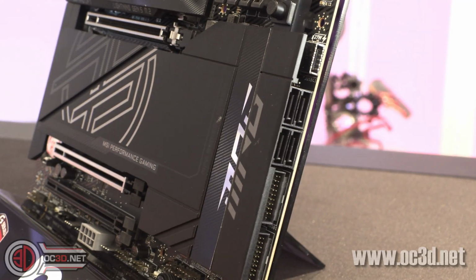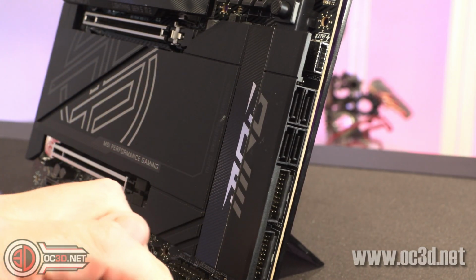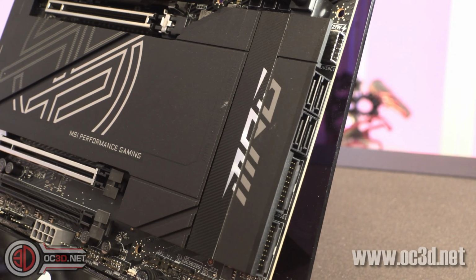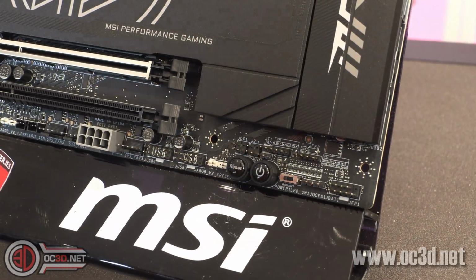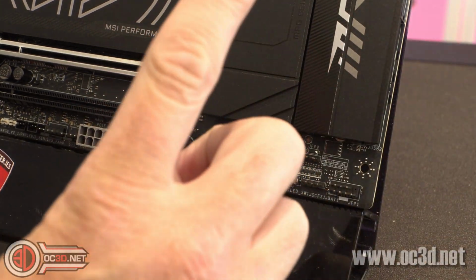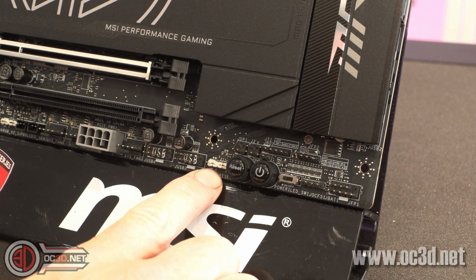And I just think that's a nice touch, and it's touches like this that make me think that the top right hand corner where the fan headers and everything are is why that feels a bit messy. Then as we move further on, normal front panel header, so lovely touch there. We've still got that as well as the proprietary connector at the top. Power and reset. You've got another addressable RGB here, so that's your second one.